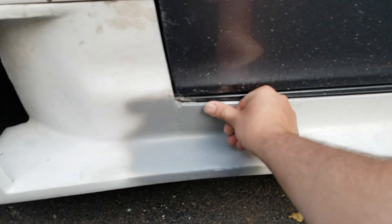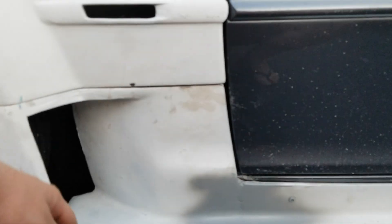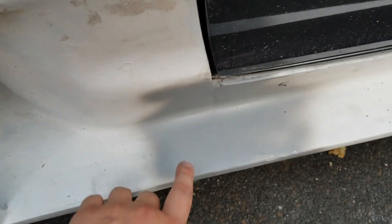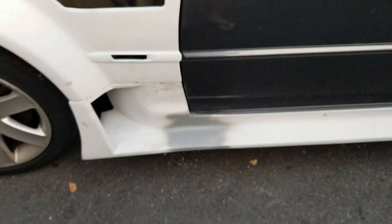I'm going to be replacing these bolts so I can push this in a little bit further. Overall I'm super happy with how it came out. This thing was a little bit floppy for some reason — the bolts broke — but I fixed it so now it's nice and sturdy. It is kind of poking out right here, probably because of the way I put the fiberglass on, so I'll sand it down to make it a little bit flusher. The rest of the body line is nice and flush. This still needs Bondo so don't mind the little imperfections — once I put the filler Bondo on, all this will be nice and smooth and you won't even tell this thing was ever a two piece.